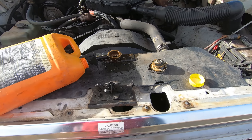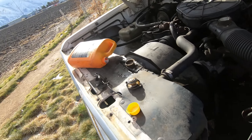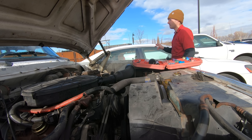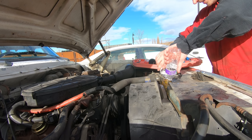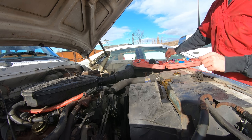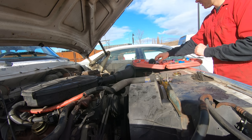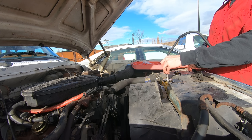Let me see if I can see air coming out. If I can't get air coming out with my pressure test kit or see some fluid, I'll go get more water. When you try to pressure test a completely empty system it takes forever to build pressure and it's hard to find the leak. Went ahead and grabbed a couple more water bottles and topped it all the way off. Just put one of these adapters on, pressurize it just a little bit, and we'll see where that leak's at. Pretty simple from here.